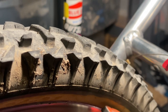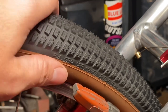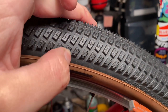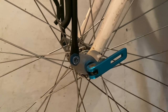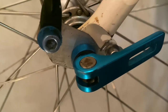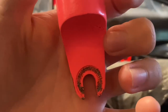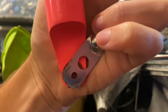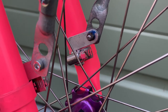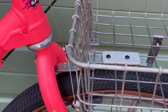Changing out the tyres now to the Billy Bonkers. I've heard really good things about them so I'm looking forward to trying them out. I don't expect them to be as good through the mud but don't care too much about that - I'll just get sideways, that's fine. They have quite a nice supple feel compared to the old Panaracers which have gone pretty hard. Mounting a front basket now in the style I normally do with a little adaptive brake kit. The dropout of the Alpinestars has a recess and no eyelet, so it's not really ideal. Because it's steel I could put a rivnut in the backside of the fork, but I decided to use hose clamps instead. People have been using hose clamps to strap stuff to their bikes for ages. Just using a bit of steel plate at the top to sandwich the rack - this is a Wald 137, quite a nice size for commuting.